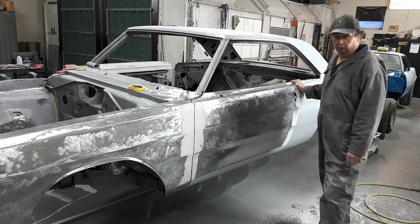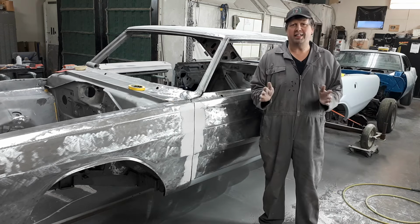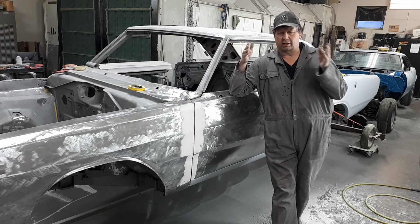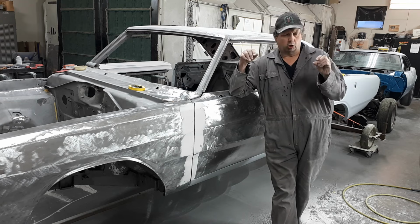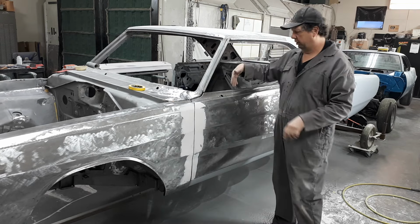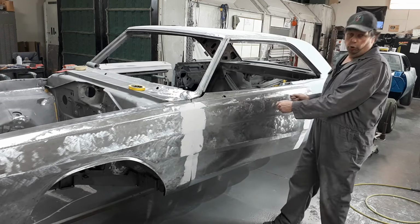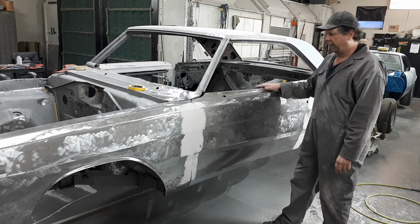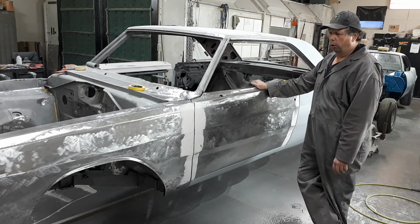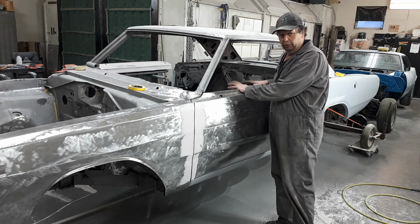You'll want the door to fit the car the way the door is going to fit the car. When I'm gapping doors, I don't have it here, but I've got a big hunk of steel. It's half inch steel plate that I went to a metal shop years ago and said, I want a slab of steel that's 25 pounds. I like that because no matter what the door, I can slide it in through the window hole or through an access hole and set it in the bottom, and that will duplicate the weight of the window, the vent window, the regulator, the latches, the handles, so that when I gap a door finally and hang it, I've got the door weighted. So that's what it's going to fit like with the glass and everything in it.